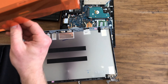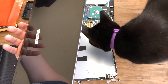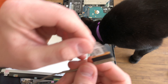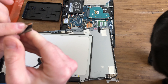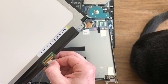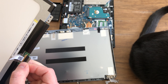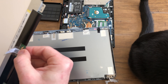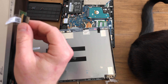I took that cable off the other screen because this replacement did not come with it. I'm going to put the cable on first before I mount it in there. These are flat-style cables — they have tons of little pins on the bottom, so you have to be careful when you put this in. It slides horizontally and just fits right in there; you'll know when it's all the way in. There's just a little tiny circuit board in the bottom which is controlling all of what this screen does.